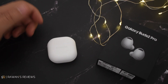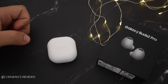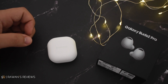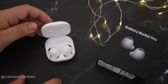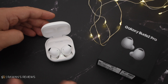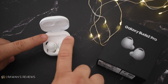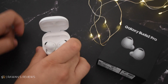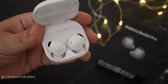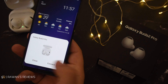Now, what could happen — which is what happened to me — is that if you've unpaired them from your phones, for some reason the phone is no longer detecting the earbuds. You open the Galaxy Wearables app and it cannot see the earbuds. As I said, there's no reset button on these. With previous earbuds you could put them in your ear and tap for three seconds to do a reset, but with these it doesn't work. What I figured out you need to do is open the case, and while the earbuds are in the case, tap and hold on both for a few seconds until you see the lights blink in green, blue, and red. Once this happens, it forces pairing mode and then you should be able to connect them again to your phone.